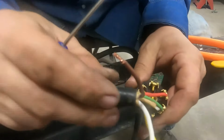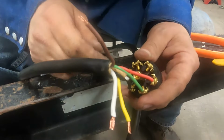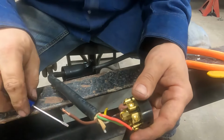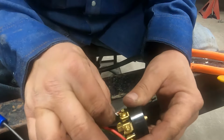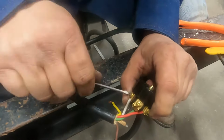So now we're going to move on to the 7 o'clock position, which will be the most important wire in six-way wiring or RV wiring, your ground. Most wiring failures result from a bad or no ground at all. You have to have a ground in 12 volt wiring or you're not going to get anything. So ground, which is our white wire, goes in the 7 o'clock position.